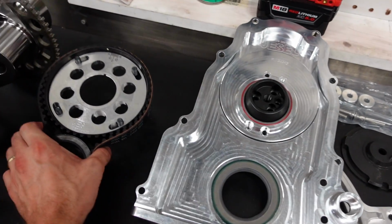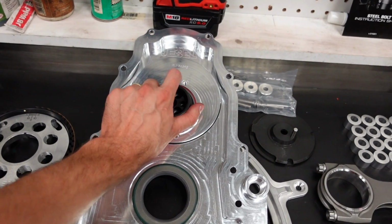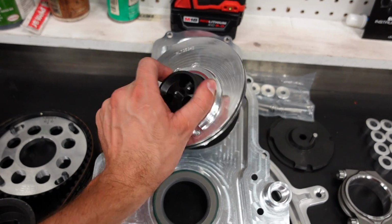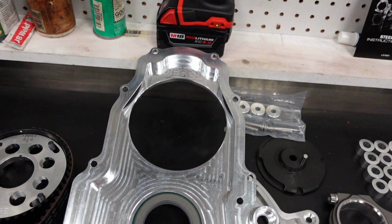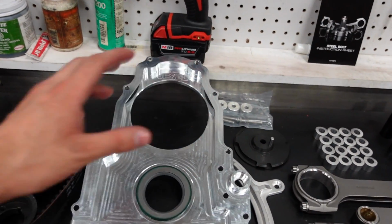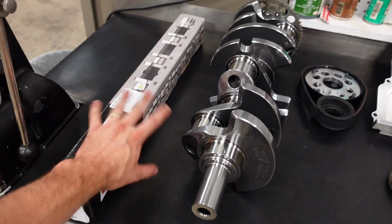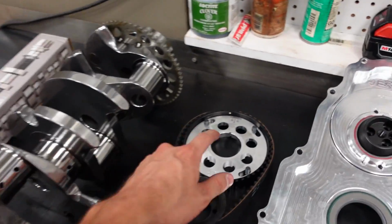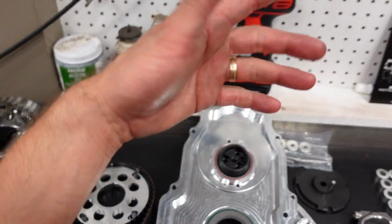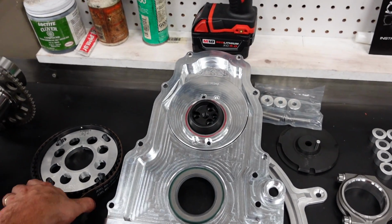Third, if you ever want to change camshafts, you can leave the timing cover installed on the engine, and all you do is pop off this piece, and then you can slide your cam straight out of the block without having to take off the timing cover, balancer, any of that stuff. So again, as a combination that's new and might need a different camshaft, if the cam specs are too far off in left field for me to dial it in on timing, it's super easy to change camshafts, get a new one in there, and get back on the dyno and see what it wants to do.